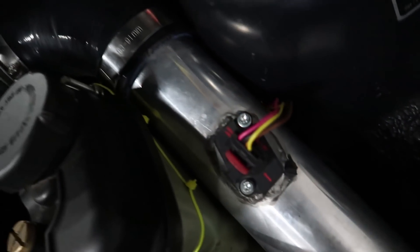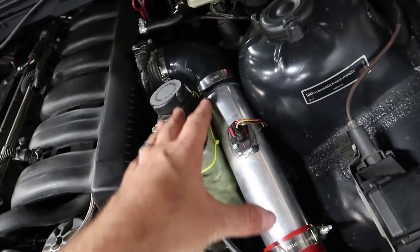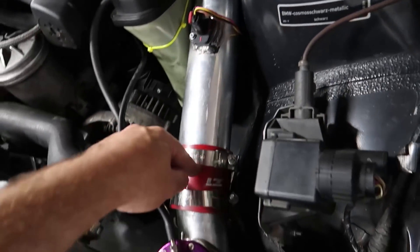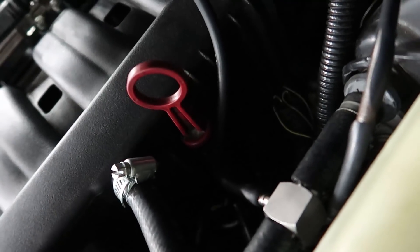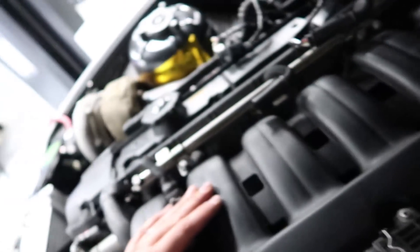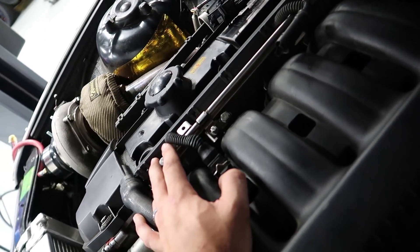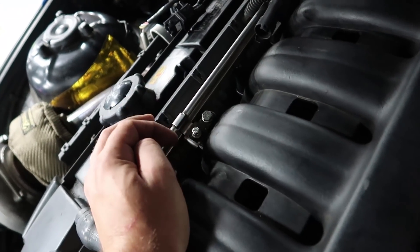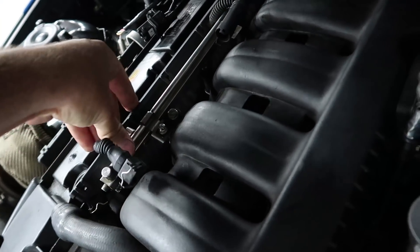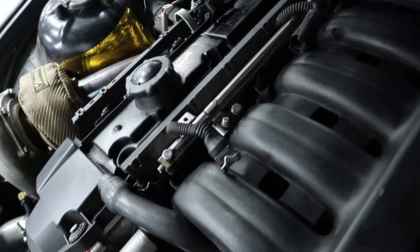After a little while, when I squeeze the trigger I don't hear any leaks. There's a little leak from my weld, but I am going to be redoing all this piping pretty soon — getting rid of this coupler here so it's going to be one piece — so I'm not too concerned. I also fixed the leak with the injectors. I ended up tightening up the bracket, taking this off, tightening it back up, and really pushing and seating the injectors down. I think they got a much better seal into the intake manifold.